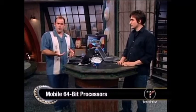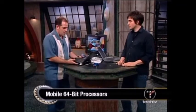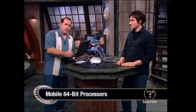Everything - homework, using it in the library. It sounds like you want to play video games though. I want something that'll be able to play Unreal Tournament 2004, Doom 3 when it ships, but I want a respectable battery life when I'm doing typing. Here's the problem - when you go for a gaming notebook, you spend a lot of money on a high-end graphics card and a big heavy-duty desktop processor. Because you generally want desktop processors for gaming performance, you end up with a 9-pound notebook and a 2-pound power supply. Your battery life goes through the floor - instead of 4 to 6 hours, you're getting into the 2-hour to 1-hour range.